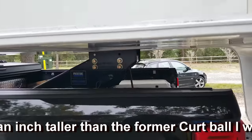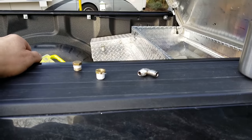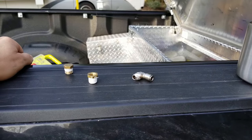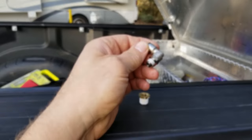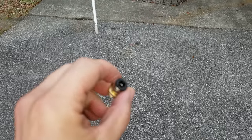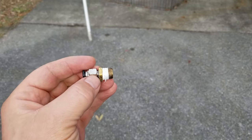We now have about seven or eight inches of clearance between the bed. After I took the airbags off my old truck I had the airlift compressor left over. Since this is basically an airbag, I decided to add the airlift compressor. I got a different fitting with the right size hole and the airlift adapter for the airline. We tried a straight connector instead of an angled connector because the 90-degree angle ran into some obstructions in the space it was going into.